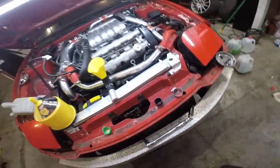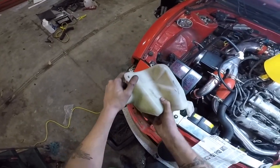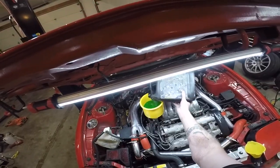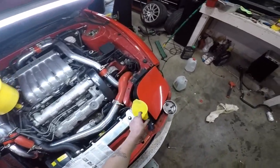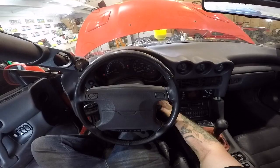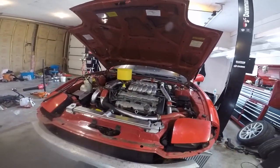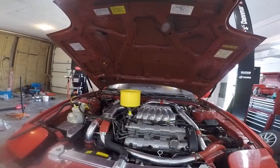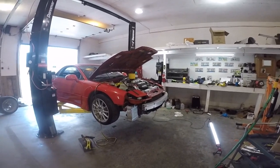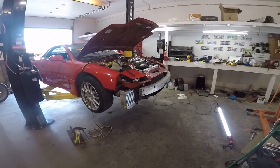This core is less than two gallons. You gotta start it and let the thermostat open up and the pump run and all that fun stuff. Running for a good half an hour with the heat on full - it hasn't really taken any more antifreeze. It's just super weird. I would think that radiator would be more than a gallon and a half. The car probably takes three gallons, but the engine was still full of antifreeze - it's not like I pulled the thermostat out.